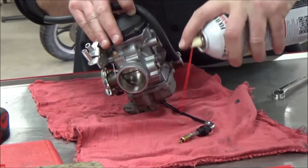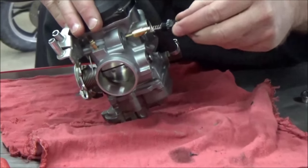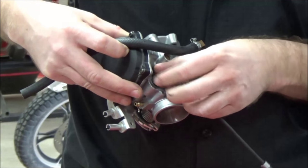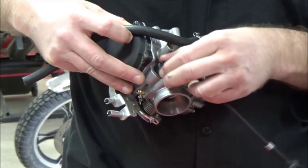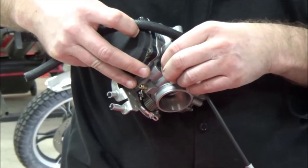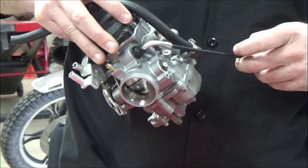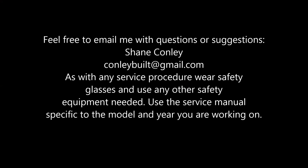When installing the choke cable, there's a rubber seat on here and I highly recommend some lubricant. This fitting is plastic — even the aftermarket world has come to the rescue for how many people have broken it. Just thread it in by hand. It's nice to do this now, off the motorcycle, so you have more room to work. Just snug it up lightly — you don't want to break it. And that is how you assemble a Harley-Davidson carburetor.